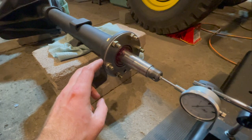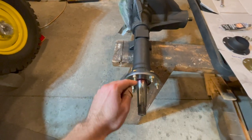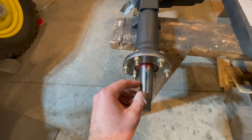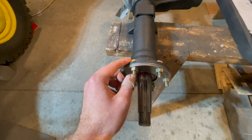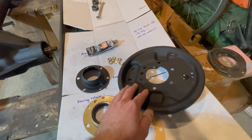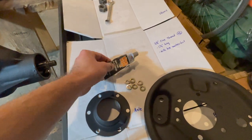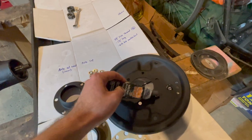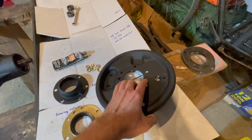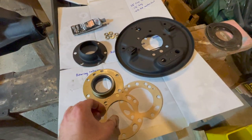Now we can continue putting on our brake backing plate. The passenger and driver side are now properly shimmed and there's the right amount of end play on your axle shaft. The next step is to take these 6 bolts apart so we can install our brake backing plate on those bolts. On the back side we'll install the right stuff gasket maker on this side to prevent any oil from seeping out, and then we'll have to flip this over when we install it. On this side there will be a gasket installed.